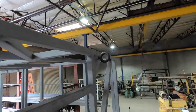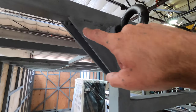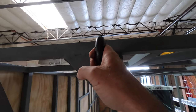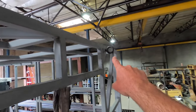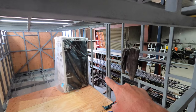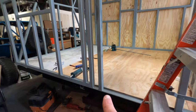Those gussets are in with the eyelets. Here is a thread-in eyelet — put these gussets in and welded the weld-through fitting. These gussets are welded on both sides, in and out. Just ground down all the other welds on the outside and inside so they are flush. These are 7/8-inch shank eyelets for mounting — I'll show you guys later what those are mounted for once it's all done. I've got one over there and one over here, just on the outside of my big back kitchen window. Next up is to put the extra door support in for my door frame, get that going, and then I can sheet the sides.